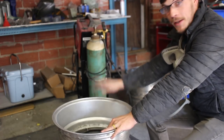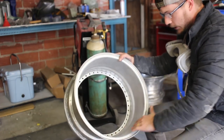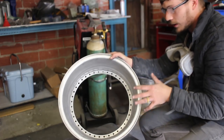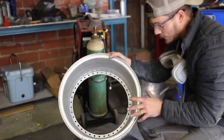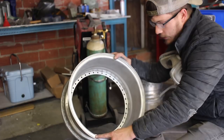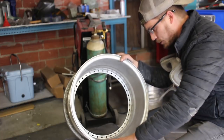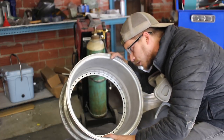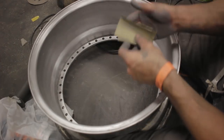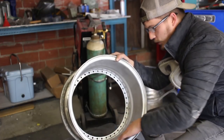Where we're at now: I've got it up to 220 grit, and at 220 it really starts to smooth out a lot. You're going to see a lot of scratches and nicks that are just there because this wheel has had a long and very hard life. This is my process. This wheel was actually repaired right here, and I'm glad I got to sand it down because I can see that the repair fused all the way together. This is super smooth — I've gotten all of the deep scratches out that I can see.